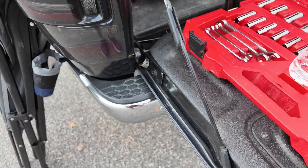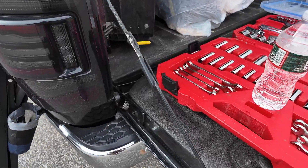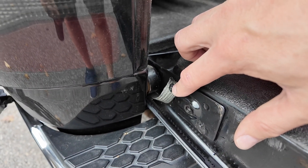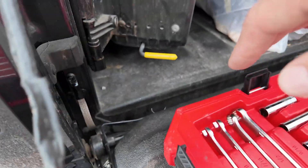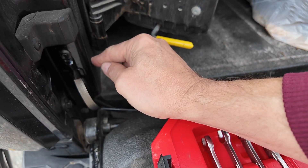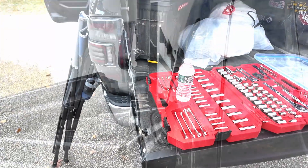You can't forget your tailgate because in essence your tailgate is another plane and it's not electrically connected to the vehicle. I had to cut the strap a little short for this one, but I bonded it to the tailgate here and then it goes underneath and ties into the frame or into the body itself.